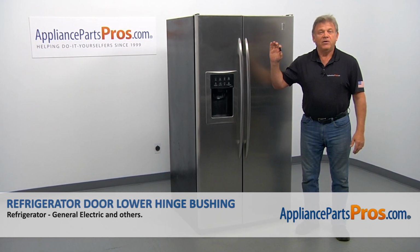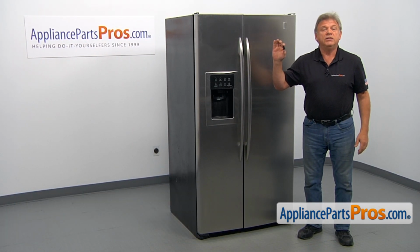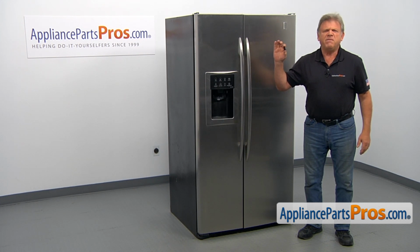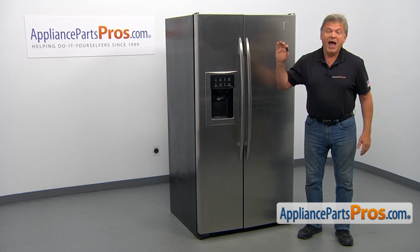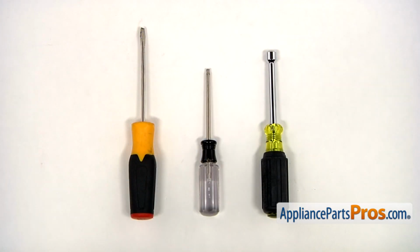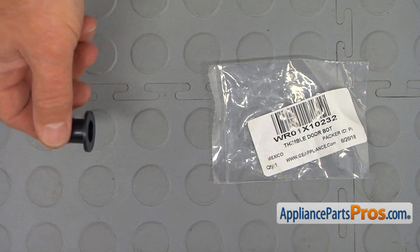In this video, we'll show you how to replace the refrigerator door lower hinge bushing in a GE refrigerator. It's going to be a very easy repair. Should only take a few minutes to show you how to do it. For this job, we're going to need a 5/16 inch nut driver, Torx 20 screwdriver, and a flat blade screwdriver. When you open up the package, you're going to get a new refrigerator door lower hinge bushing.